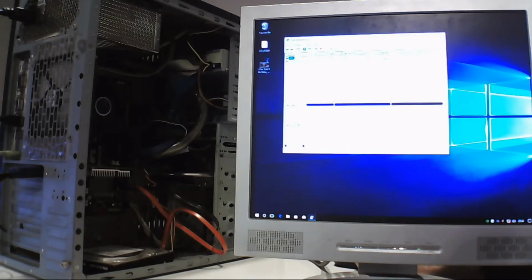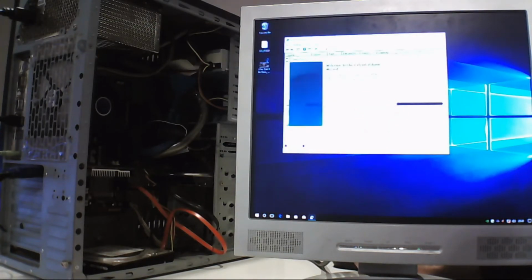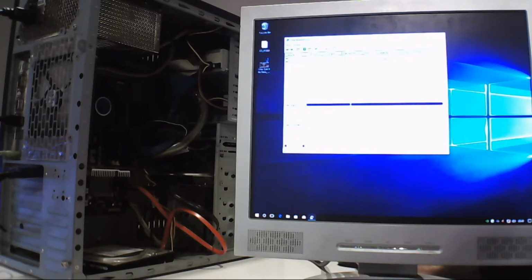So we can either allocate it to another drive, so you've got 2 drives on 1 disk, or you can select the partition, and then you'll be able to extend the volume. What this does is it will extend that and fill up the rest of the drive. So you can set the amount. I'm going to set it to max, click next, and then finish, and then this will extend the entire partition, so now the entire drive is full.